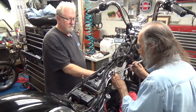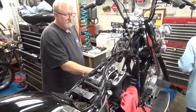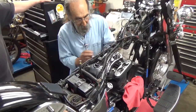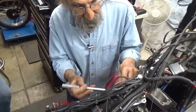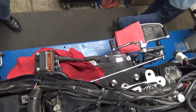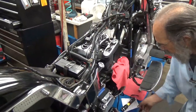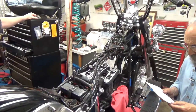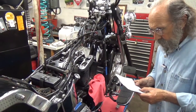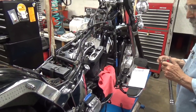So, accordingly, I do it the way the manufacturer of the gaskets intended. So what I'm going to do is put the first head on, which we just did, and we're going to do the first torque setting according to, again, the manufacturer of the gaskets, the way they want them done. They want, in sequence, tighten all head bolts to 9 pounds. It's 9 foot-pounds.